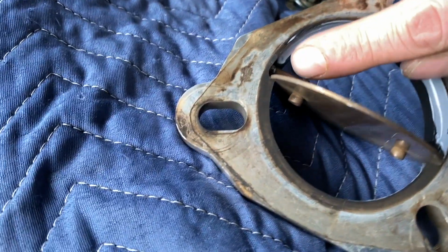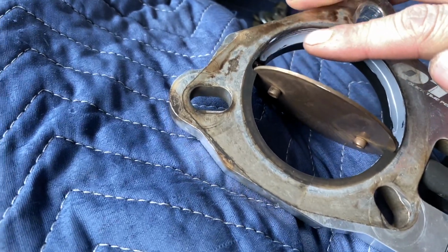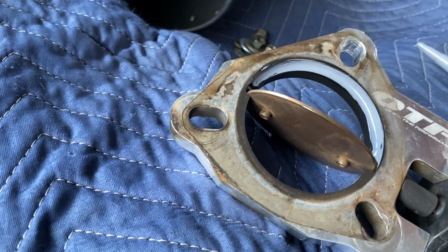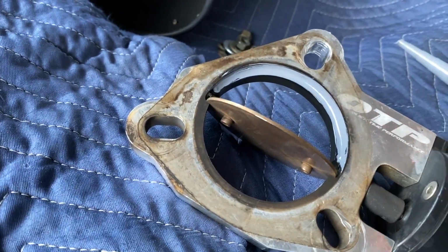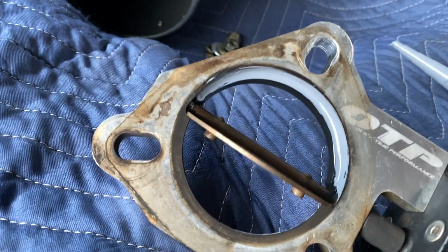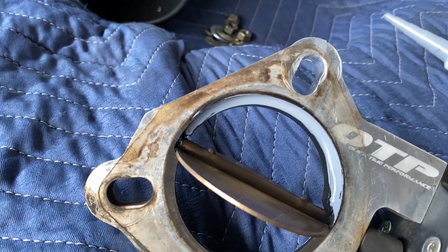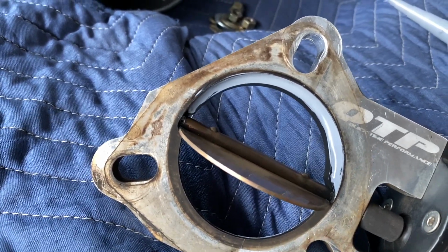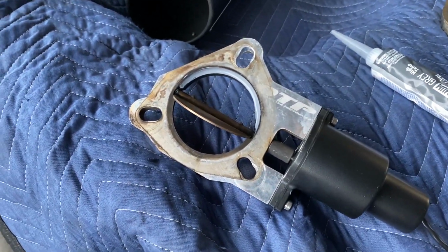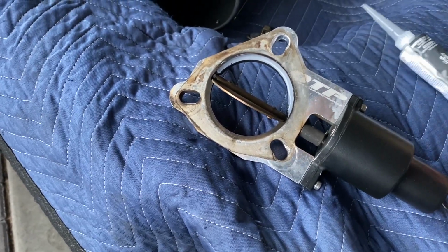I use my finger because you kind of want it concave, I don't know if that's the right word. You want to have it a little rounded in there, nice and clean, not too much. It has to be even. You want it nice and smooth. Let it dry for at least, I would say, 15 to 16 hours before you put it on, and 24 hours before you close the blade onto it. It takes 24 hours to cure. Make sure you really abide by those times and instructions.